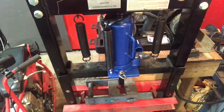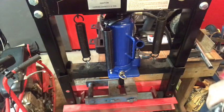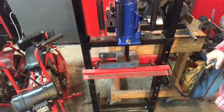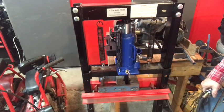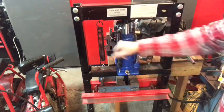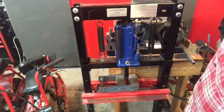So this jack — you can use it like any ordinary bottle jack with the handle if you don't have access to air. But I do have access to air, so it just hooks up to this valve and lever here. When I first got it I was a bit worried — this jack is a little heavier than the standard one — I was worried the springs wouldn't have enough strength to pull it back up. But the jack itself has springs attached to it, so it's not a big deal at all. Pulls it right back into the open position. Works really good.